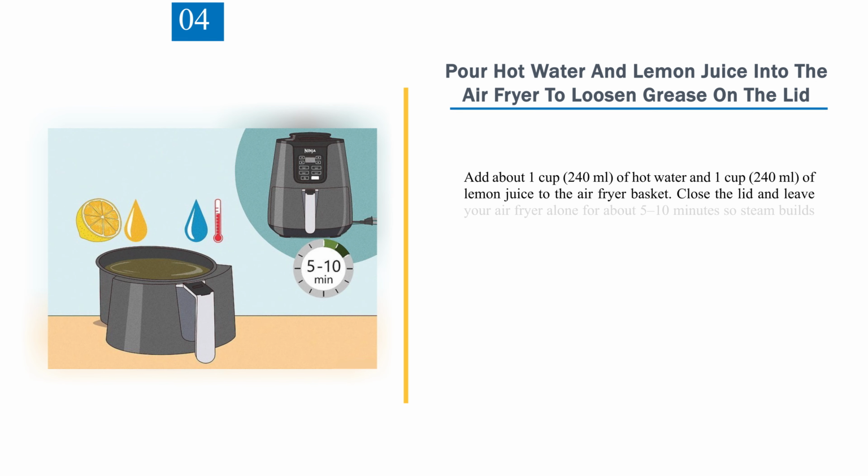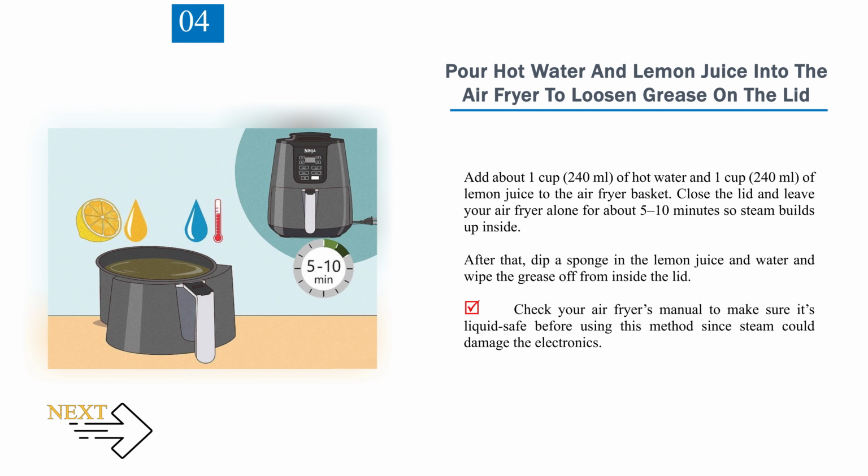Number 4. Pour hot water and lemon juice into the air fryer to loosen grease on the lid. Add about 1 cup, 240 milliliters of hot water and 1 cup, 240 milliliters of lemon juice to the air fryer basket. Close the lid and leave your air fryer alone for about 5 to 10 minutes so steam builds up inside. After that, dip a sponge in the lemon juice and water and wipe the grease off from inside